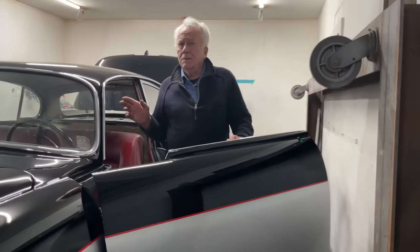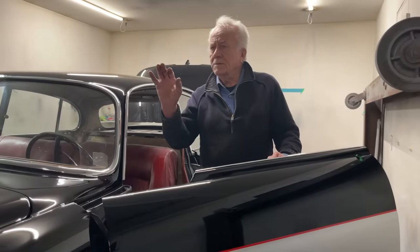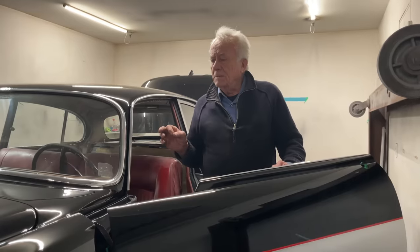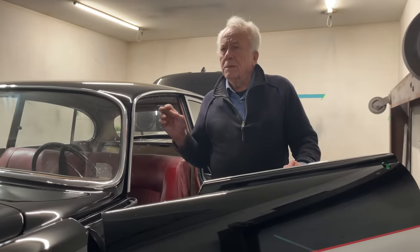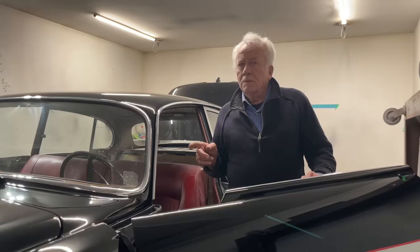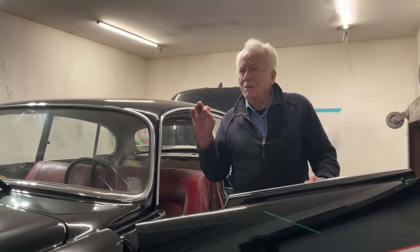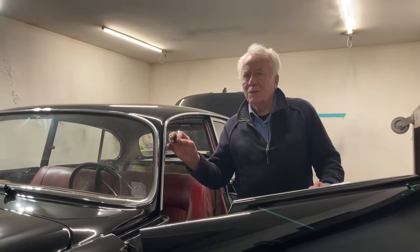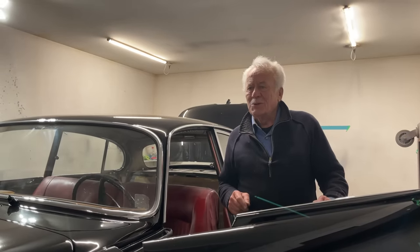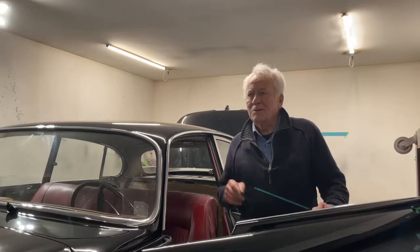Yeah, until this little sensor senses that it's heated up. And if you do that a couple of times and don't let that clear, you can flood the engine. Okay. And then it's a hell of a job trying to clear it. And that's what we were trying to do before. And then Jeff shorted that thing out to disconnect it. Yes.